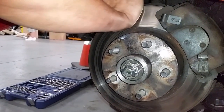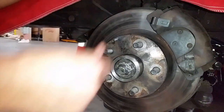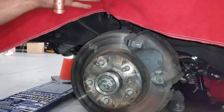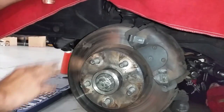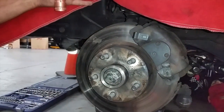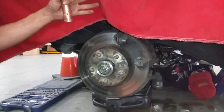There's minimal play — this is exactly where you want it. Not too loose, because when parts are too loose they'll eventually end up breaking as you put load onto the car, but no locking up either. I'm going to spray some brake cleaner on here to remove any grease and fingerprints from your rotors, and then we're going to slap the wheels on and bleed the brakes. We should be wrapping this thing up soon.